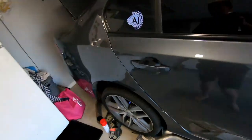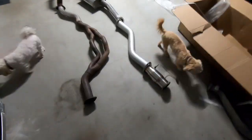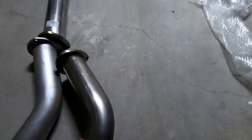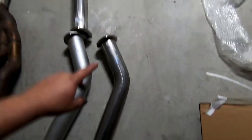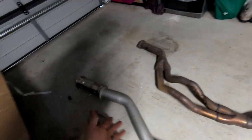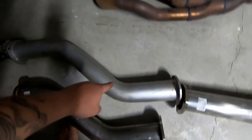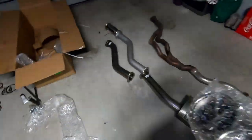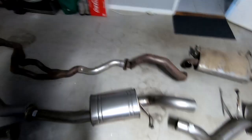Here's the side-by-side comparison. This is actually a cat-back system, so you can buy just this system here and it'll bolt straight up to the factory cat if you don't want to get your car retuned — that's what you can do if you want to avoid a retune. I'm obviously getting the full system done, so this pipe's different and suits the rest of our system. I'm also returning this pipe and the unopened tip back to Muffler Madness to help them out, since I have to go back anyway to get the muffler delete done.